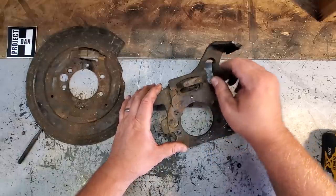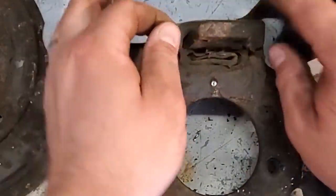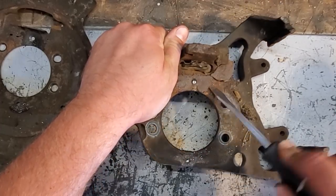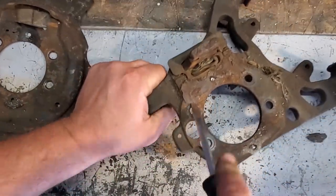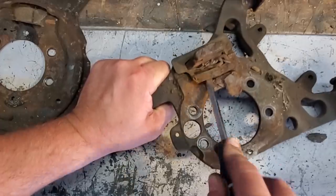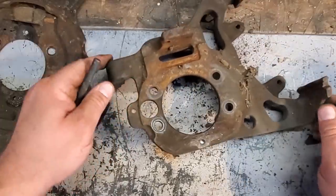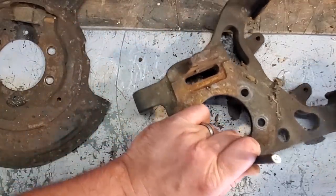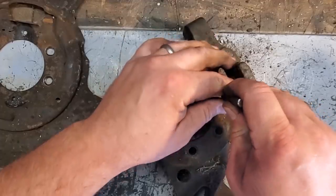Look at all of this rusty nastiness — this is your parking brake lever boot and it's so crusted and rotted on that we're not going to be able to salvage it. She's rusty and crusty. This is brittle and charred — we are not going to use this boot. Back to our rivet hole: here's a 3/16 punch — again, 3/16 is very important. Pop that rivet right through and we'll do the same on the other side.